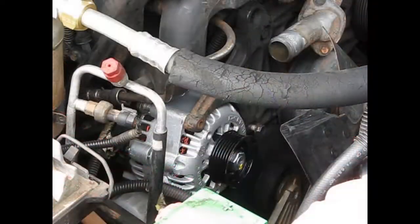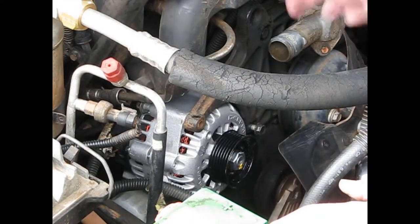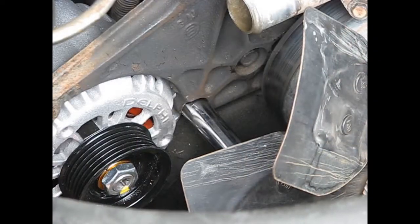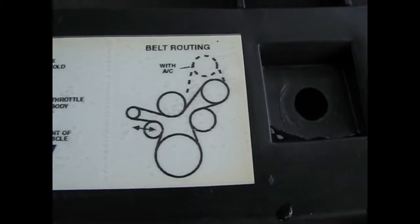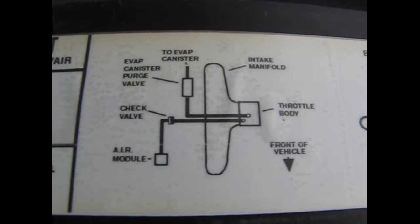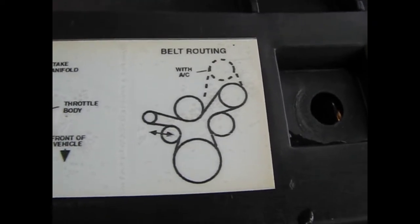Now that I've got all the wires put on I can start putting the bolts in. I put it in place and I've already started the bolts — short one here, long one here that comes in from the backside — so now I'm just going to tighten those bolts up. If you forget how your belt is routed, you should have this diagram on your fan shroud. The top fan shroud has all your information — it's got a vacuum diagram and your serpentine belt routing, so if you forget how the routing goes you can always come back to this and look.